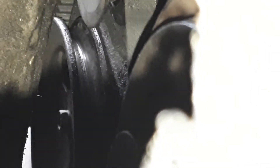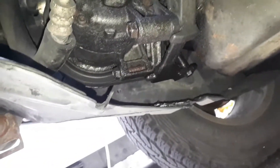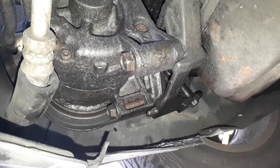Once you've taken the cover off, you can see the belts, the pulleys, and the compressor. That's the drive belt — top one and bottom one. Now let's loosen them and drop them out to see how bad they are. First, undo the bolt on the compressor — there's one underneath. Then move to the alternator. Remember, underneath the compressor there's a little pulley in the middle that will come off first, then alternate the two bolts on top. And you can just take the belt out.